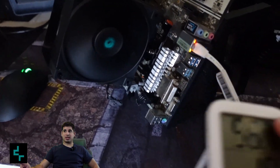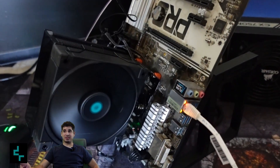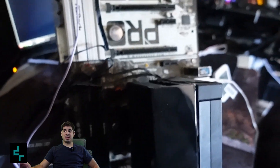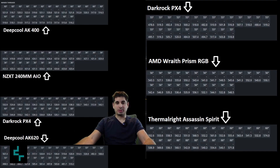12 hours later, running the 3900X at full load — 97 degrees ambient — the cooler didn't get above 84°C. I was very impressed. There was absolutely no airflow in this room, and it was about a 110 watt load. I was very happy with the AK400, so I swapped out the bad cooler that was in my farm and put the AK400 back in.